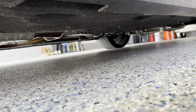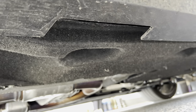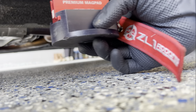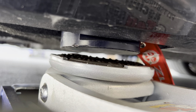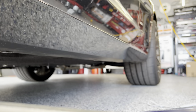We're going to dive under here and take a peek at where the pinch weld lift points are. You've got three of them on the Camaro. You've got this forward one here — that's the front of the car that way. Then you have the midpoint pinch weld here, you can actually see it there. And then there's one way, way in the back, right about there. We take this premium magnetic jack pad and line it up with the pinch weld. We'll use our jack to lift the car from the middlemost point, and once we have it high enough, the lift points will go here and on that way-far one back there.